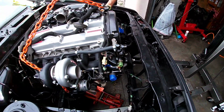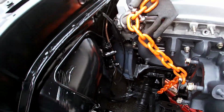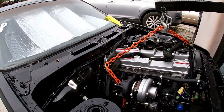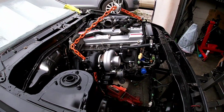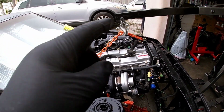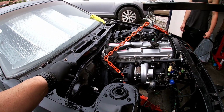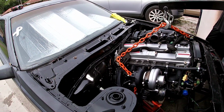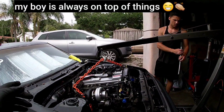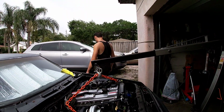That's past. Mounts are getting close. Transmission's down in the tunnel, and we're up against the firewall here at the moment. Acting out to come back a bit. So the issue we have right now is that our chain is at an angle, and I'm not under there pushing up on the transmission. So I can get the jacks up there now. All right, so get the jack free, and then we can get the jack underneath the rear of the transmission, and then we can adjust the angle.